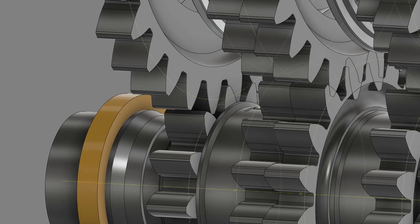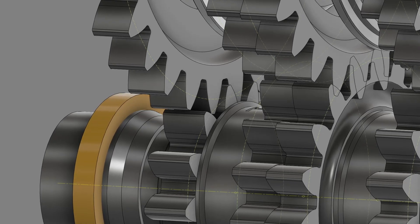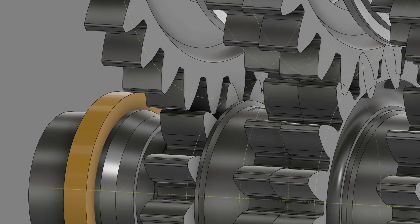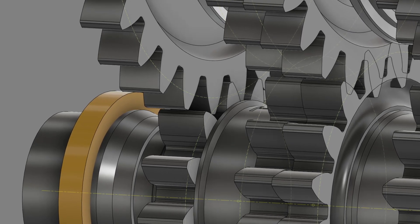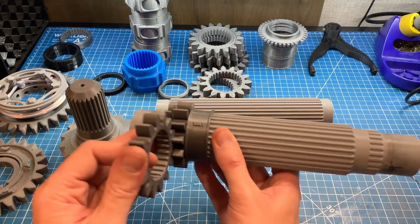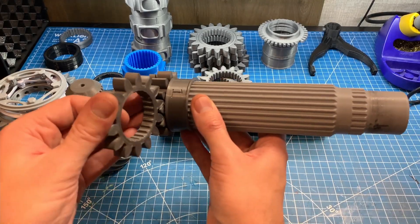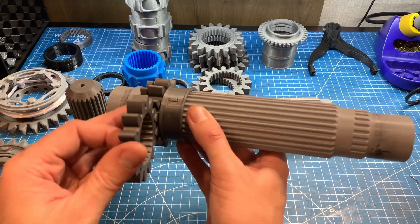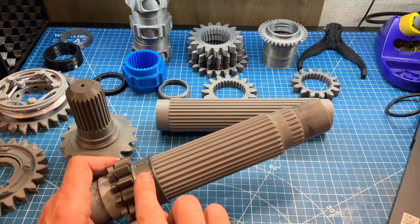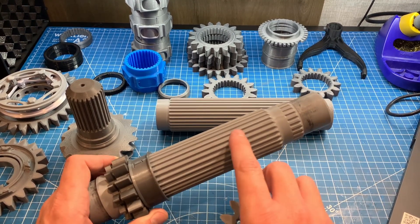This took me a while to figure out, but you can see this on the actual real gearbox. The reason for this is the root diameter of the gear is smaller than the spacer diameter can be. This extra one millimeter in width actually keeps the spacer from being able to foul with any of the gears from the main shaft. So the gear order starting from the front of the gearbox is 1, 6, 7, 8, 3, 4, 5, and 2.